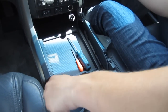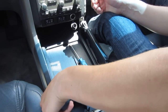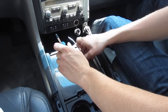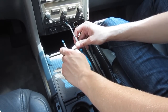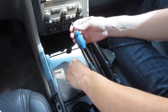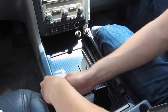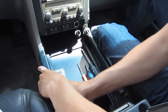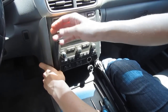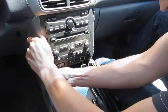The only other way is to use some kind of a clip removal tool, but there's a lot of chance you're going to scratch the panels, so this is an easier step. I forgot to mention what tools you need — you'll need a Phillips screwdriver and some kind of clip removal tool. You can also use a flathead screwdriver. You don't need many tools. A Phillips screwdriver is one of the most important things you'll need for this car. As you can see, when I lift it up, this panel pops up itself, and then you can remove it. Make sure you remove it first to the side and then lift it up.